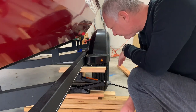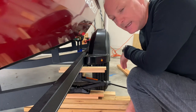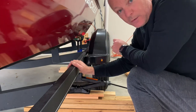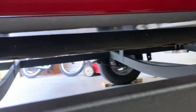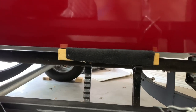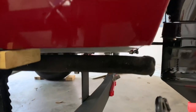I got a DIY setup going — I just used my car jack from my SUV, lifted the boat up by the trailer frame, and put two jack stands in the back. When I lowered the trailer it raised the boat off the bunk, so I'll be able to do one side at a time. As you can see we've got space to work with — two jack stands and a carpeted two-by-four to hold things up — plenty of room to remove the old bunk and put in the Ultimate Bunk Board.